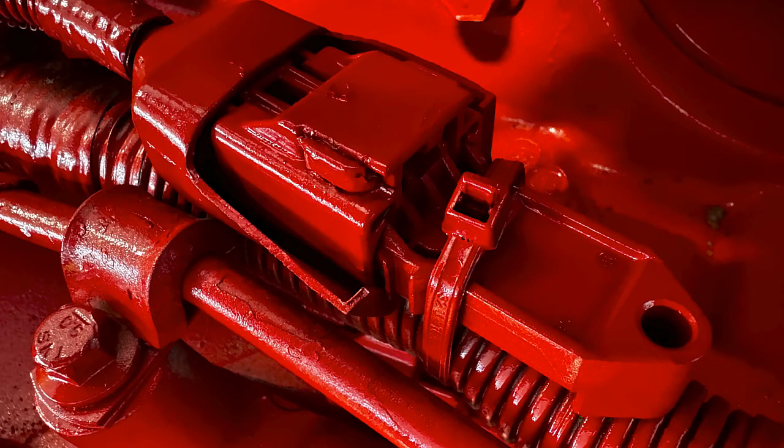You never used to see these on naturally aspirated engines or low-horsepower engines. After about 2007, I've not seen an engine without one — if it had a turbocharger or EGR on it. Early on, those engines used the boost sensor to zero all the other sensors. Now that they have the ambient air pressure sensor, it's the one they use to zero everything. Thanks for joining me on Engine Shop Joe — see you next time.